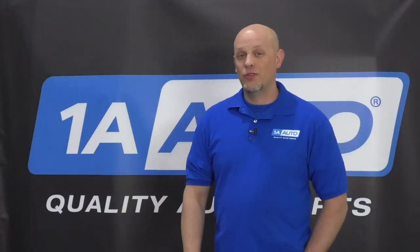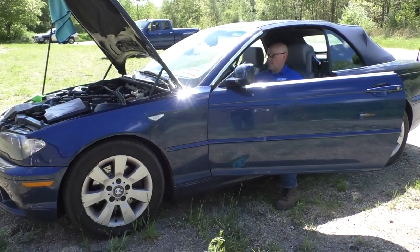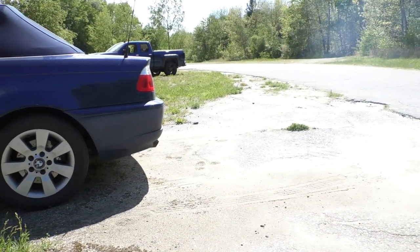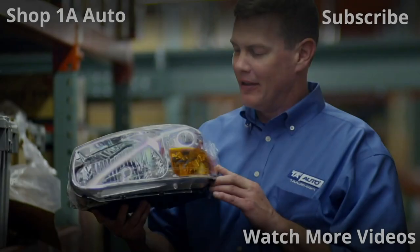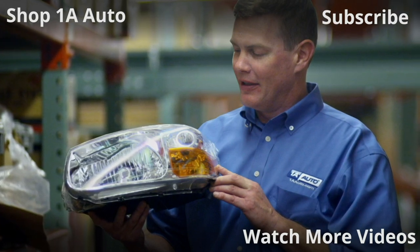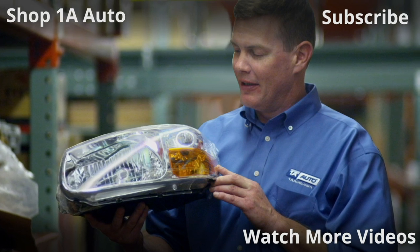Once you're done with the fuel injection cleaning, you're going to want to start the vehicle and let it run for a while. It may run really bad right away. The check engine light might come on — you're going to clear the code, let it run, drive it around. After a while, this car felt great. We cleared out the problem and you should be good to go. Thanks for watching. Visit 1AAuto.com for quality auto parts shipped to your door, the place for DIY auto repair. And if you enjoyed this video, please click the subscribe button.